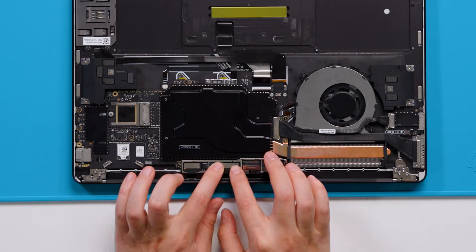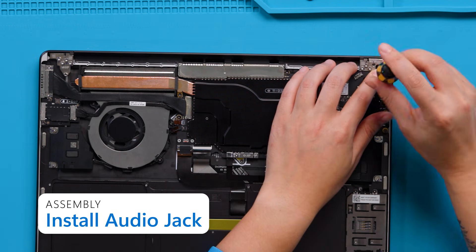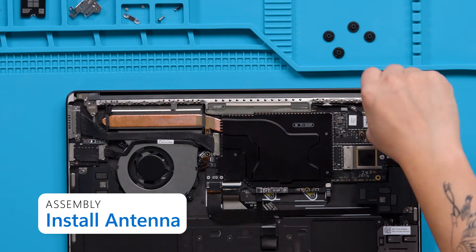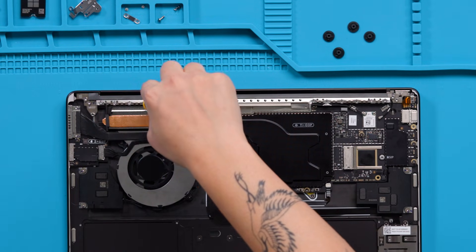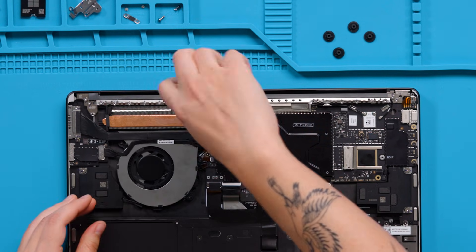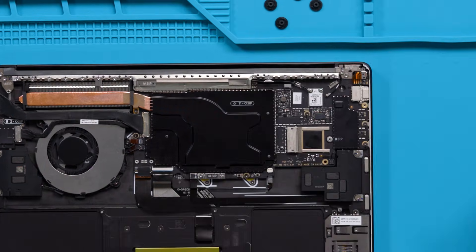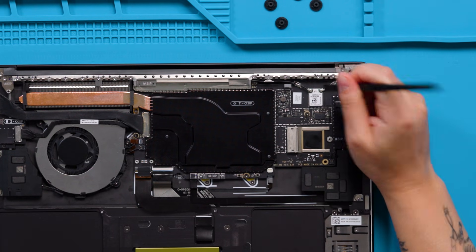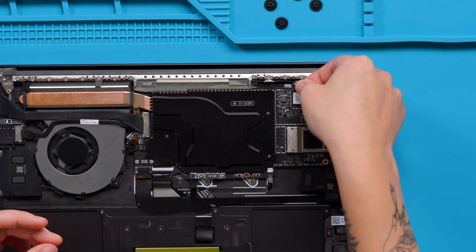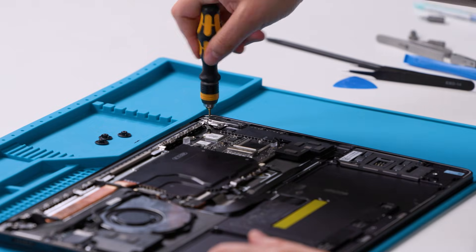Connect the display connectors to the motherboard. Install the connector shield. Install the audio jack. Place the audio jack into the chassis. Install one 3IP screw. Install the antenna. For 13-inch devices install 12 3IP screws; for 15-inch devices you'll have 14 3IP screws. Connect the two coax cables to the motherboard by aligning each with the socket and pressing down until a click is felt. Install two new coax cable lids to the motherboard over the coax cables and align and press into place until a click is felt. Install the audio jack bracket with one 6IP screw and two 3IP screws.